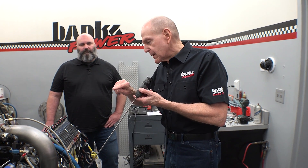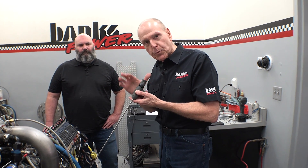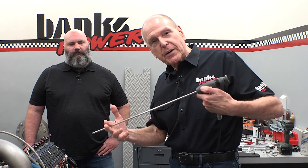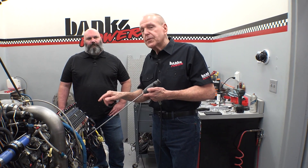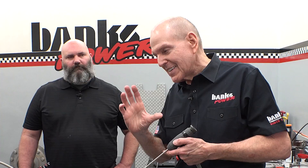That allows me to look at the piston, the combustion cup in the piston, and that radius I always worry about. I can look at the bore — you can still see a lot of crosshatch, the bore looks cherry. You can take the piston all the way down and follow it anywhere, looking at the entire cylinder wall for scuffing. We can also check the valves independently by rotating the engine to open and close them, seeing the seats and the integrity of the valve job.